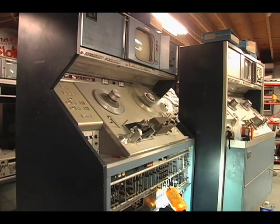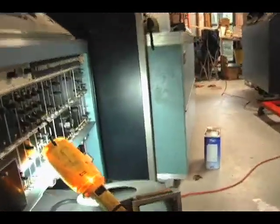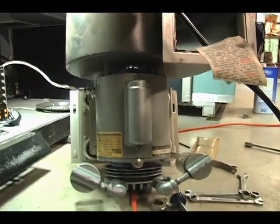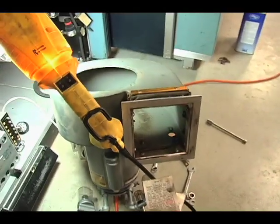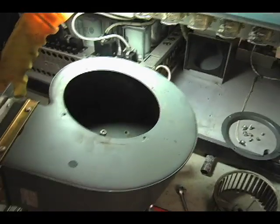The first major problem with this machine after powering it up is it has no cooling blower and no vacuum pump. The vacuum pump and the cooling blower are run off of the same motor. I've got it out here already — it goes down in this little corner. I had to take the power supply regulator out and a few other things. Here's the motor that's bad — it reads open. This end is the vacuum pump end, and this end is the cooling blower. I've spent about an hour getting it out.